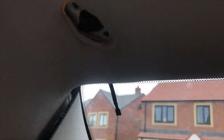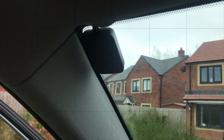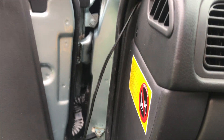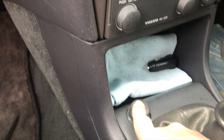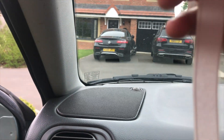Some people said to scratch the paint away or mount it to a bolt or screw, however I don't want to scratch the paint — but that's what I've been advised looking at forums on the internet. The aerial is going to go there — I just need to clean the window, but you can just see the magnetic part. I've scratched a little bit to make sure there's a good earth and a good piece of metal there, hopefully giving a better signal. It's mounted, it's all secure, and I've hidden the cable. I'm going to try routing it through or behind the glove box.